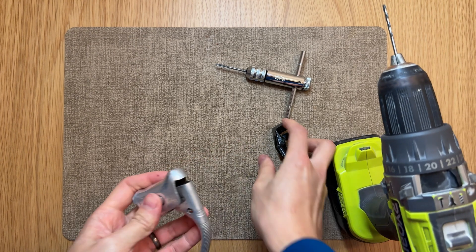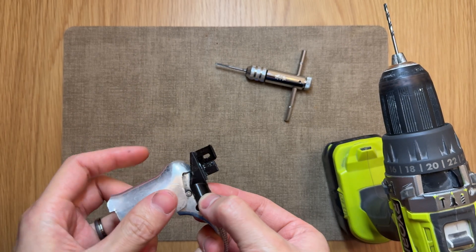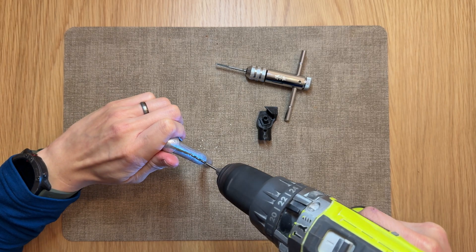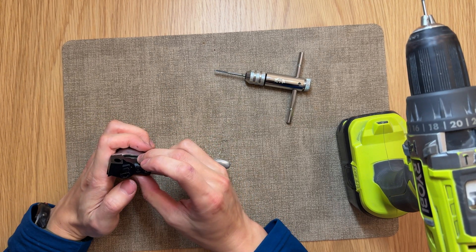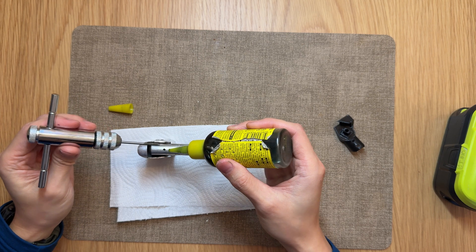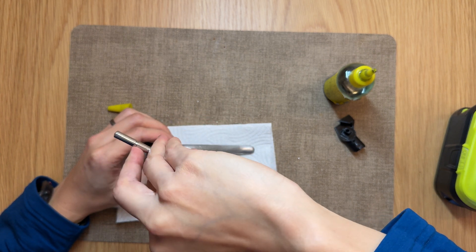I'll play a couple of clips from when I was installing the prototype of these brake levers, since the process is similar — you're just drilling a hole and tapping it. If you want to see this in more detail it's in the cheap bike build-off video I mentioned. Definitely don't do what I'm doing here by not using a vise to clamp it — it's quite dangerous if it slips. Note that this prototype used two M3 holes instead of one M3 and one M5, so just ignore that part.